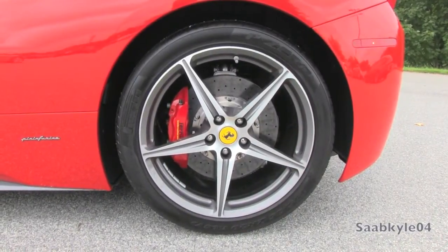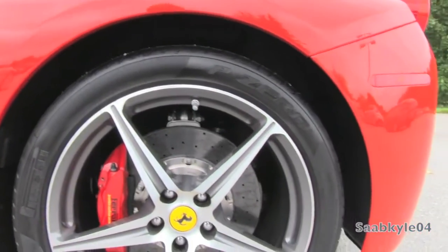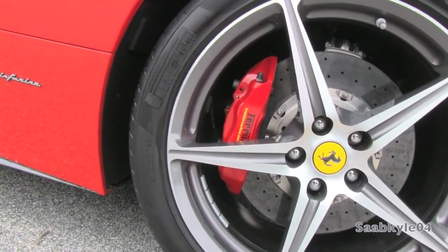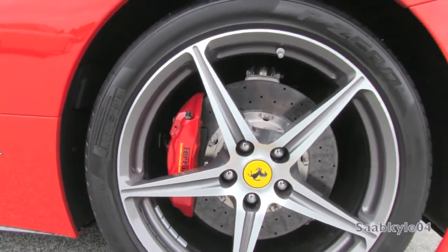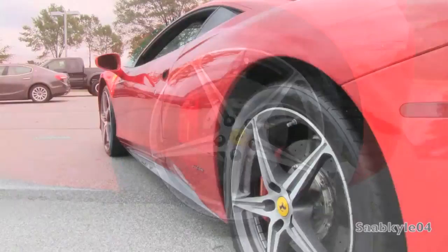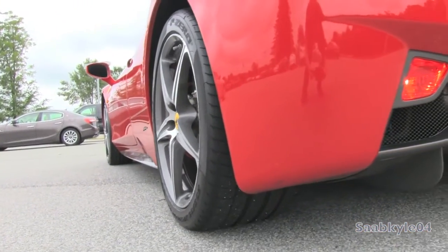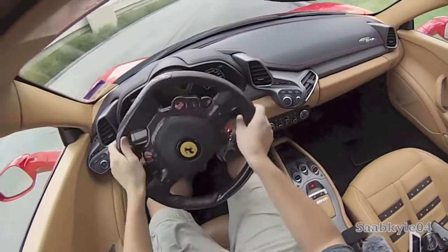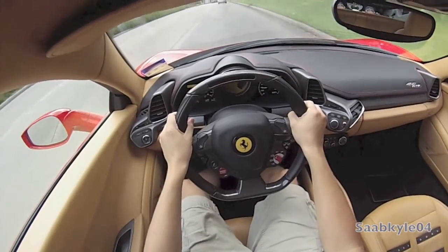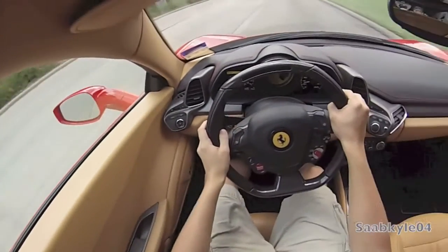Taming all of that power are standard carbon ceramic cross-drilled and ventilated Brembo disc brakes, saving 20 pounds over conventional brakes. Consisting of 15.7 by 1.4 inch rotors in front and 14.2 by 1.26 inches in the rear, clamped down by 6 piston and 4 piston aluminum calipers respectively. With this setup, the 458 stops from 60 miles an hour in about 107 feet. Added bite is provided thanks to a system that preloads the brakes with abrupt throttle liftoff, reducing the response time